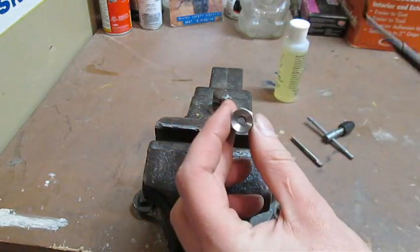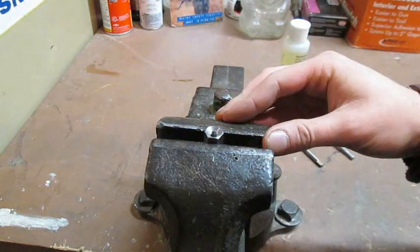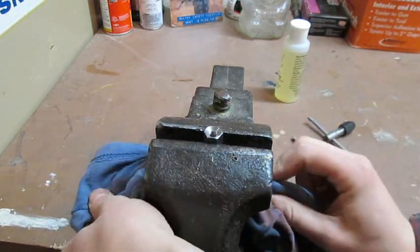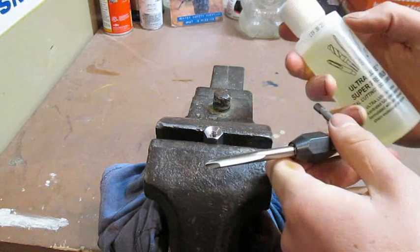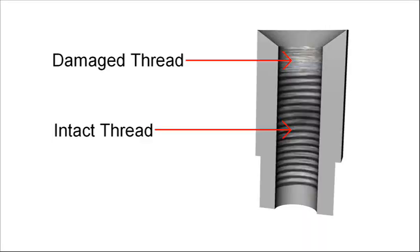The first step in repairing this stud is to remove any loose pieces of metal lodged into the threads; I just used a basic cleaning pick for this. For proper tapping, the lug should be clamped vertically — this will help keep the tap lined up precisely with the axis of the hole. Sticking a rag under the stud will catch any cutting fluid that drips through. Whenever you're using a tap to cut threads, it's important to use some type of lubricant to prevent damage to the tool or the threads you're trying to repair. The objective here is to use a tap to re-thread the stud's damaged section, clearing any metal that will interfere with the stock bolt's threads and meeting up with the intact threads below.